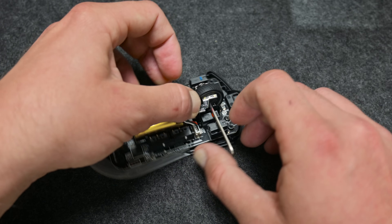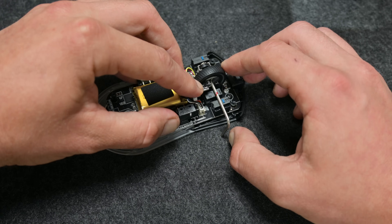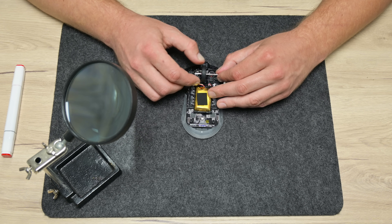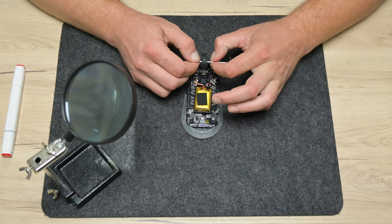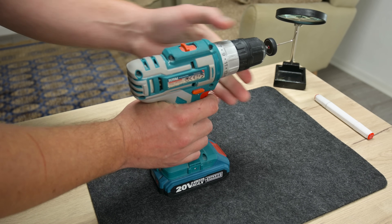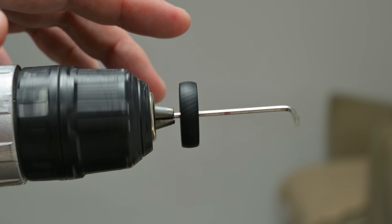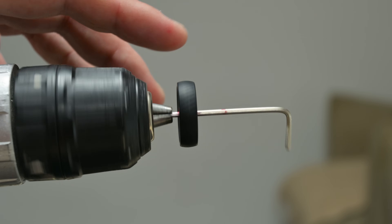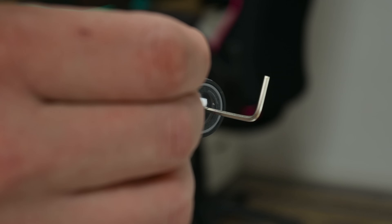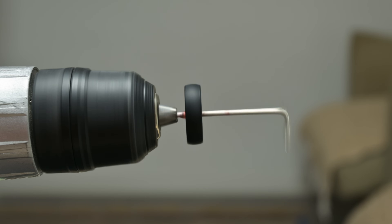Now I move to make other measurements, adjusting the wheel and the LEDs. This mouse has LEDs that are inside the scroll wheel. After I got a clear picture of how and where everything is going to be, I have to do another adjustment and that is balancing the wheel. I put the wheel on the hexagonal key and put it on the power drill. Here we can see how the wheel is not in balance. But carefully and slowly, bit by bit, I found a good spot for the wheel. Now I use glue to stick the wheel in place, and finally I got almost perfect balance.